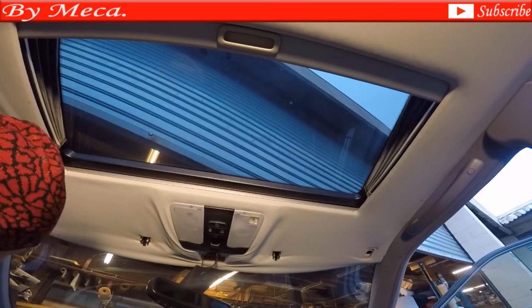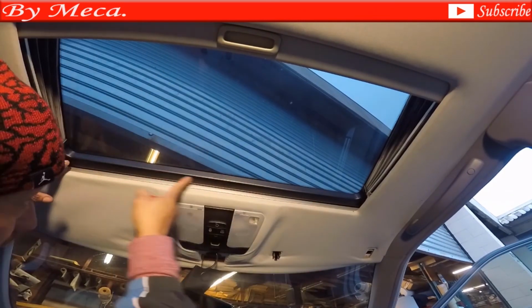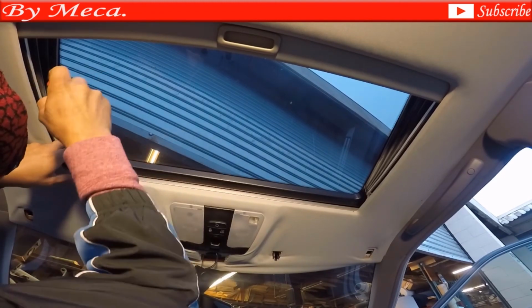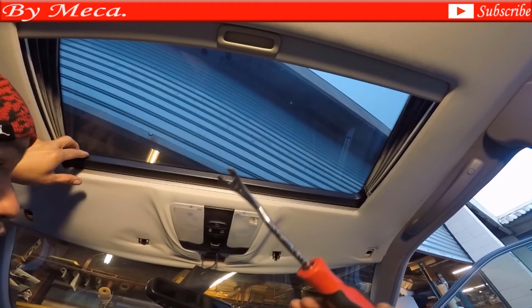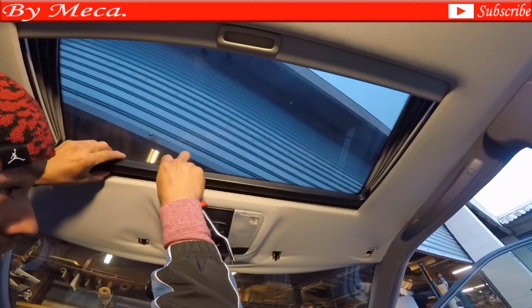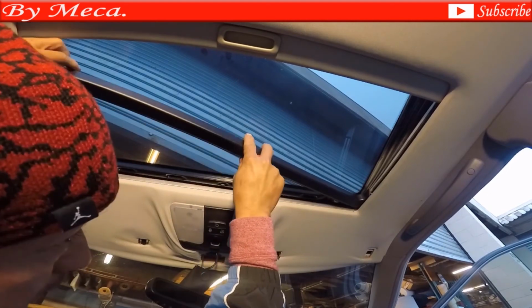And first I'm going to remove this plastic, that black plastic. Be careful with that plastic because most of the time it's toasted. I'm going to use a door panel clip removal tool. That's the name of that tool. But you can use any flat screwdriver. You will be able to remove it with that tool too.